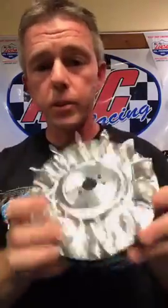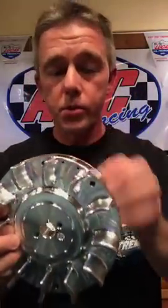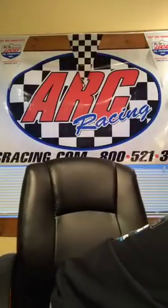Now, a lot of people say this looks like a 6619. Dang, all the flywheels I brought home, I ain't got one here either. This is a little bit smaller than a 6619. Like I say, these flywheels are size specific in order for that coil to work right. So the 6619s, the 26s, the 25s, the 6689s, they will not work with a PVL ignition. And for those of you that want an adjustable,